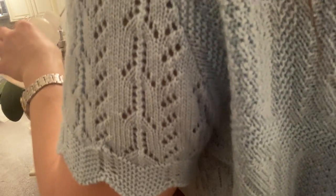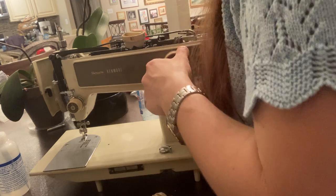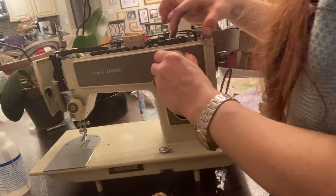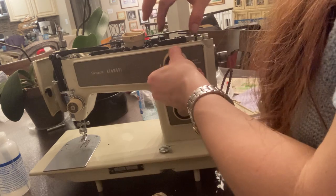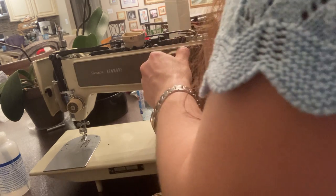I've heard the whole blow dryer trick. I've actually used an open torch before on an all-metal machine where the gears were fused shut — so yeah, you can. My concern is that people are using this a lot on machines that have plastic on them. I would not touch this machine with a blow dryer because we have plastic parts — this one that drives this is a plastic one. So we have a couple plastic pieces on here; I would not risk losing them.